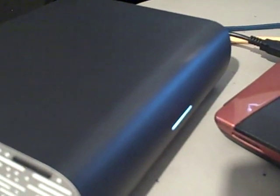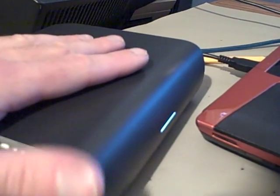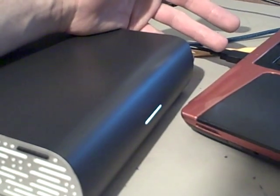Here's another gripe I have with it. You can hear it accessing right now. There is no drive activity going on according to Resource Monitor on Windows 7 — it's showing zero kilobytes per second disc I/O. This is further proven when I actually remove this drive from Windows. If I eject the MyBook, you can still hear it accessing. So something internally is going on — the controller is accessing the drive for some reason, and I don't know why. I really don't like that, because the hard drive shuts itself off once you physically unplug the USB cable from the computer. And I don't know what's going on — it might lose data.